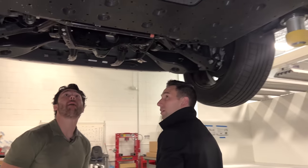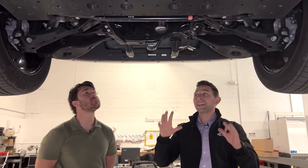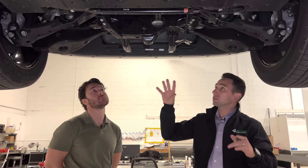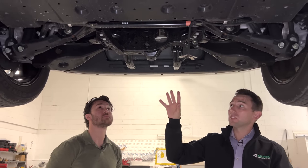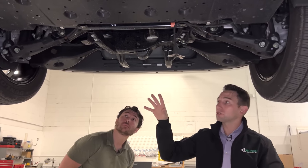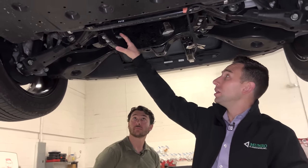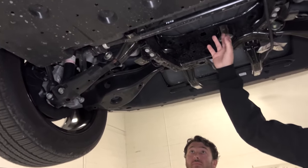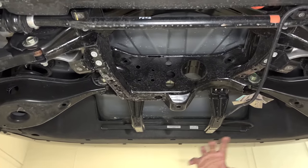So from a suspension architecture perspective, again, very conventional. As we see with most BEVs, the rear suspension and cradle system is isolated. The version of the vehicle that we have is front wheel drive only. And so you're not seeing the half shafts, although you are seeing provisions for isolators for drive units in the cradle. Spots to mount them.